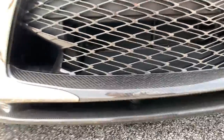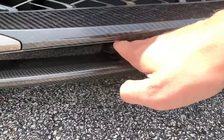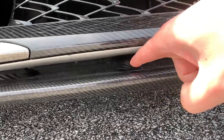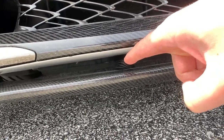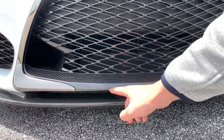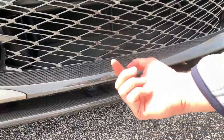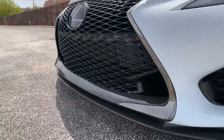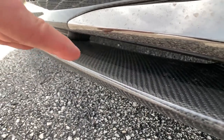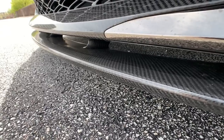In between here you can see those two pillars, one and two, and the lip kind of goes downward like this. The reason that's happening is because these two mounting pieces right here — how they mount on the GS350 — they don't sit perfectly on the GSF. So I'm going to have to trim those back pieces so they fit into the groove, and then I can use a screw to mount this up so it sits a little flusher. When I get home from work today I'm going to go ahead and do that and show you guys the steps.